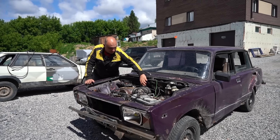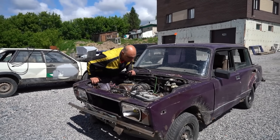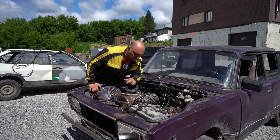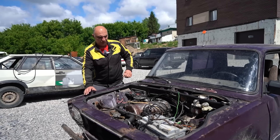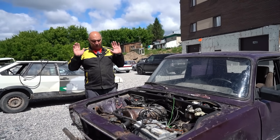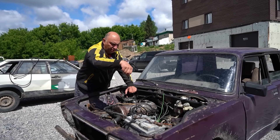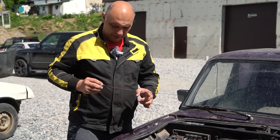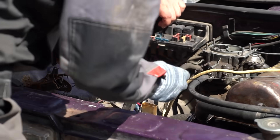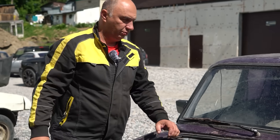Half an hour later. Okay guys, we're looking pretty good here. We let it run for half an hour. The oil filler cap looks nice and clean, and everything next to it is also looking good. The cradle is clean. You really don't want to smell this stuff. Might as well start dismantling it right here, because if we bring it inside it is going to seriously stink up our facility. At the very least we should drop the oil and remove the valve cover — we should get a fairly good understanding of how it worked. The oil really doesn't look that much darker. It seems the dipstick has oxidized, but the oil doesn't look too contaminated. Let's crack it open and show the people what's up.